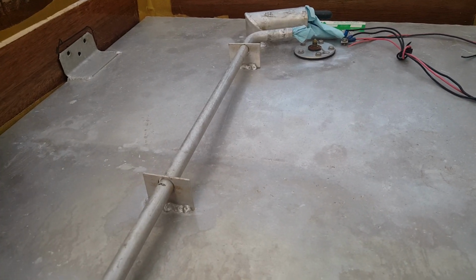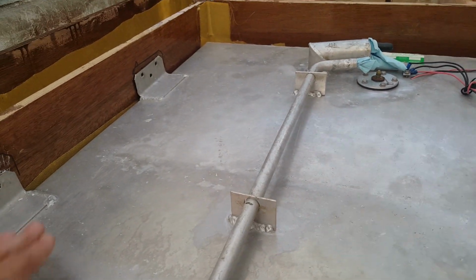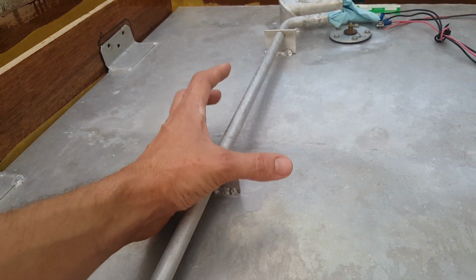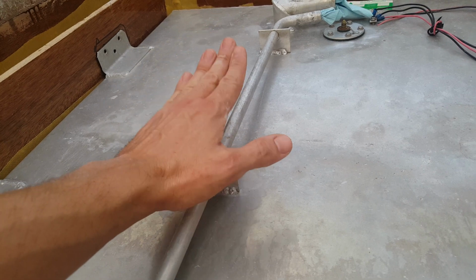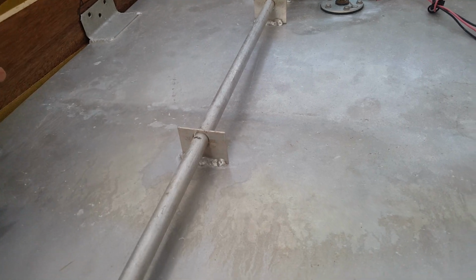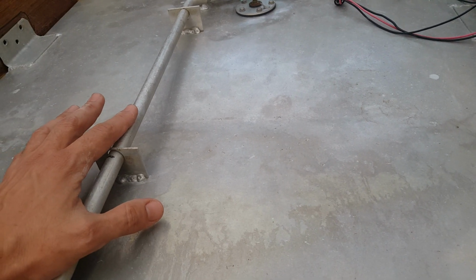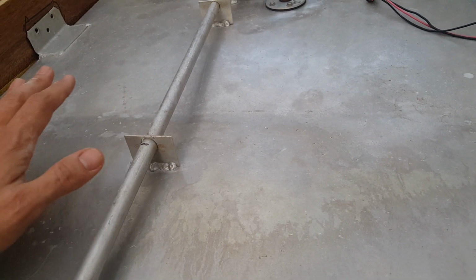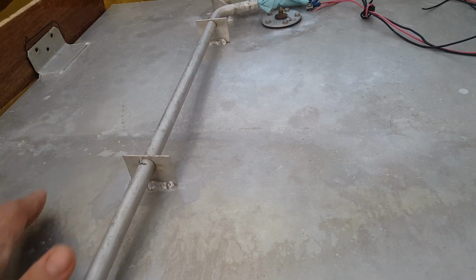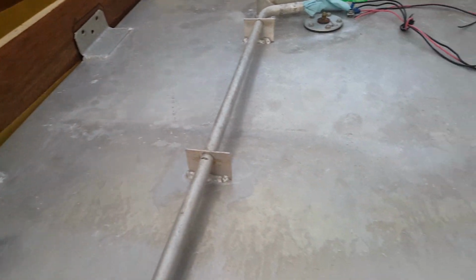And my thought was to put a 2x4 right across from left to right, and I also thought maybe we can do a vertical piece of marine grade plywood across too and just make a notch. But if you think about it, if you make a notch in it, over time it's going to crack right where this notch is. So we need some type of wood that is the same all the way across from left to right, so as people are walking on it, we both know that it doesn't crack. And also we want to make sure we're not having to cut around this piece, because we both know this vent tube is almost directly in the center. So some things to consider here.